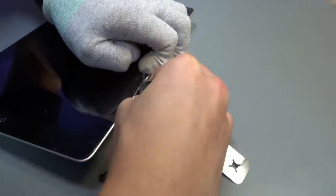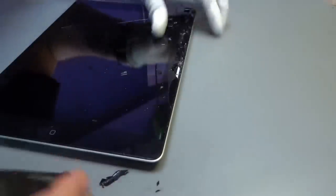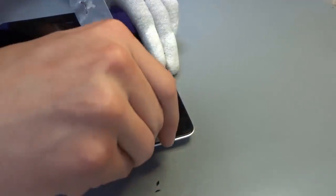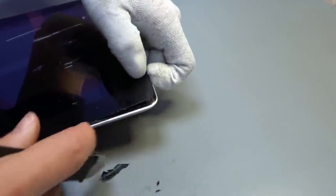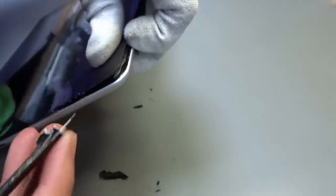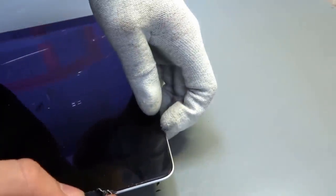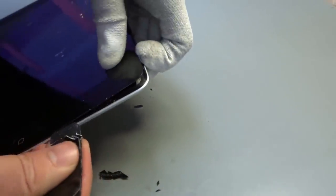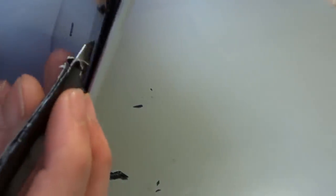The iSesamo is a fantastic tool — tools and parts at appleipodparts.com, and there's a 10% discount for YouTube users in the description. Damien is using his left hand to gently lift the glass while prying away with the tool, helping lift the adhesive and break that seal. Normally we'd spin the iPad around the desk, but we're keeping it on camera. He's making sure not to put the tool in too far — about 4mm — but being extra careful near susceptible areas.